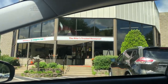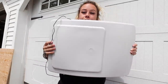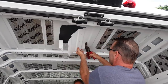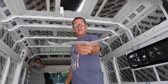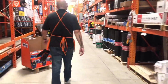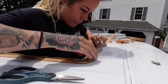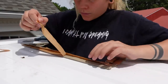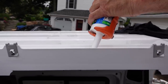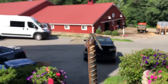Now for the final step for this week: installing the MaxxAir fan in the roof. I found an open-box fan at a camping store for $163, which is half the price of what they usually sell for. Like the windows, we started by drilling a hole in the roof so that the saw could fit in, but we decided instead to use cutting pliers to cut out the hole because it was a lot easier. I used the rust prevention stuff again on the cut metal parts. Then we went to Home Depot to grab some roof sealant, butyl tape, and nails. We cut and placed the butyl tape in between the grooves in the roof to make the surface somewhat level, then placed more butyl tape on top of that so the whole edge where the vent was going in would be covered. We placed the part that holds the vent in and screwed it down, then squeezed roof sealant on top and let it set overnight. The next day I put the fan on top and screwed it in, and then our work for this week was complete.